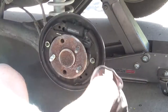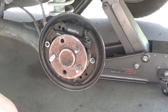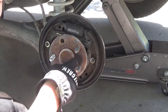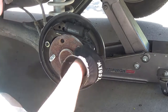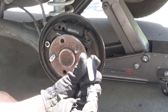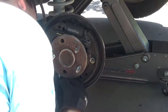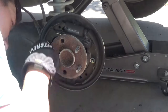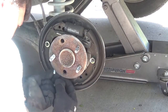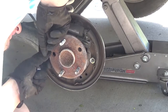So we're going to have to see how to take these off, because as you can tell there's no slots to put these in. Normally, the newer Japanese cars have holes right around here — the newer Camrys and Corollas. This is an older one, a 2003. You can kind of slide the stud back in and move it around, then pull it in. What I like to do is put the nut on the impact and cinch it down so it pulls it towards you and gets the knurls in. But it looks like we might have to take... well, maybe not. I might be able to wiggle it in here, but it is not going to be fun at all.